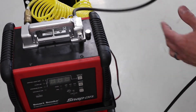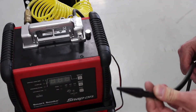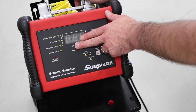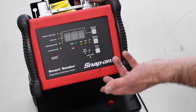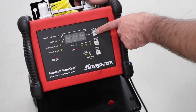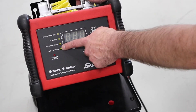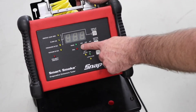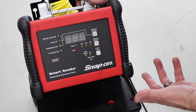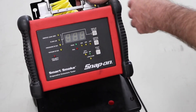The other output is this smoke hose — it comes out in just this small hose. Up front on the controls, there's a digital display. Many of these machines use an analog gauge and flow meter, but this one does it all digitally. I can display leak size, flow, pressure, or vacuum. I can also indicate the type of leak orifice I'm after, which is useful because the EVAP monitor looks for a specific orifice size and I can match that on the tool.